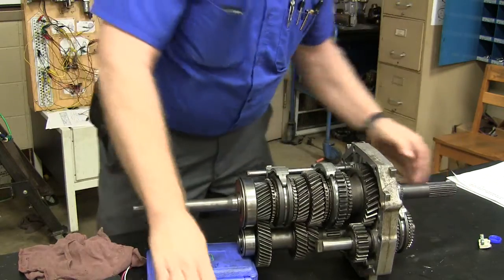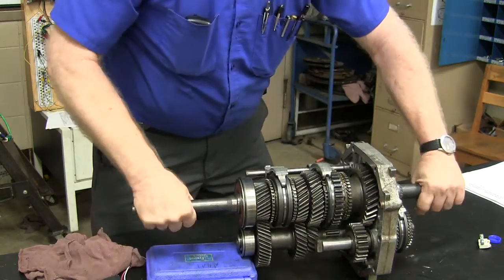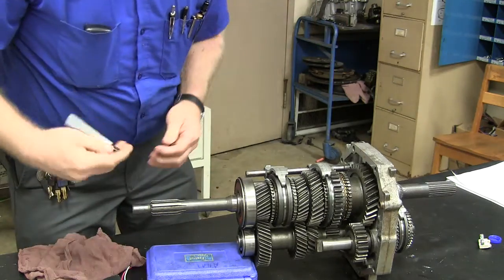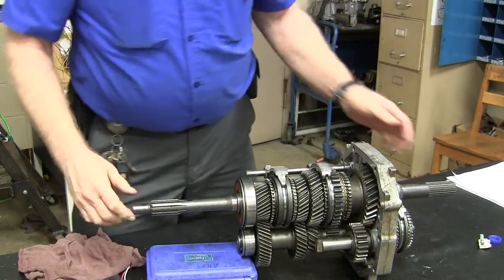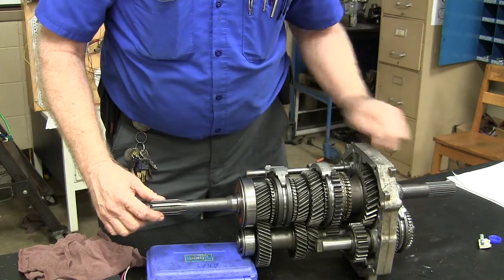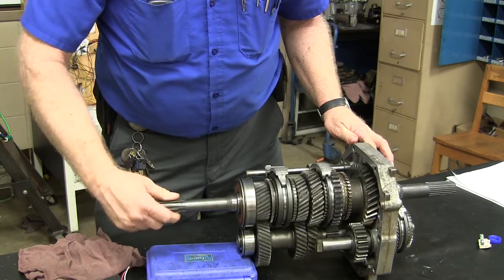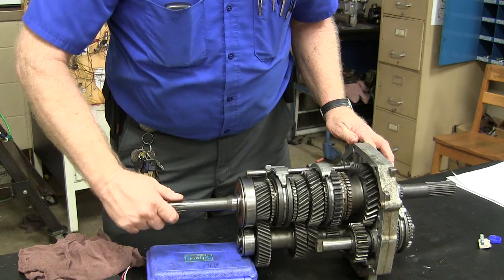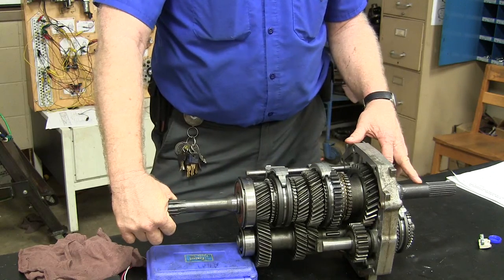All right, you see there? Now then, if I move that forward, that's second gear. Now let's see what that ratio is. We got that one on top. Let's make a new mark right here on this one. We're going to turn this through — I'm going all the way around. I've passed it once, I've passed it twice. When that one comes up, that's like two and a half to one. So that's your second gear — you were three and a half, now two and a half, you know how you're going up through your gears.